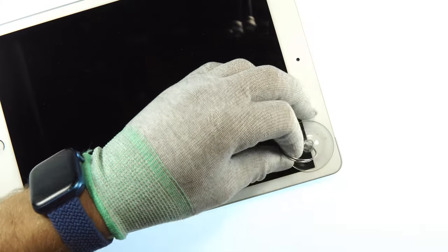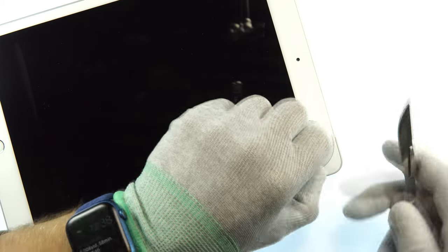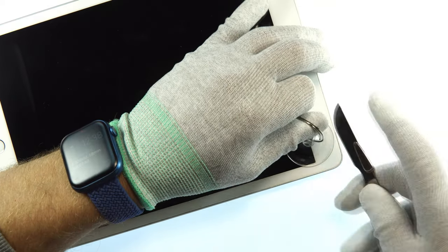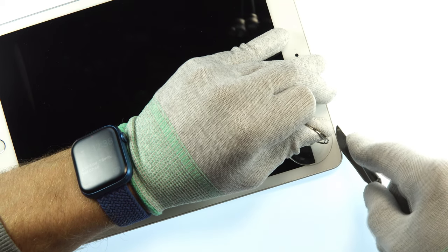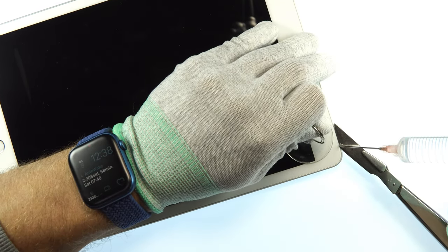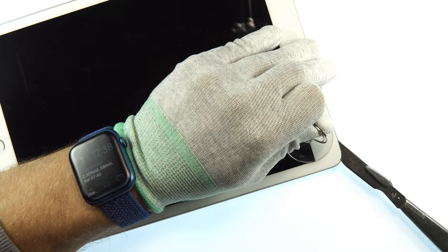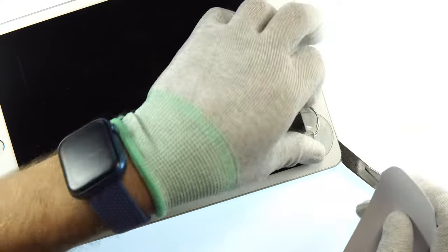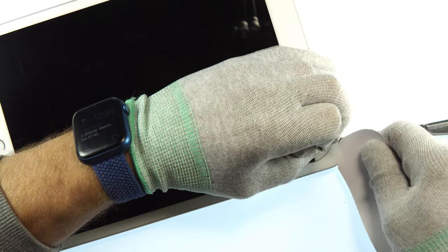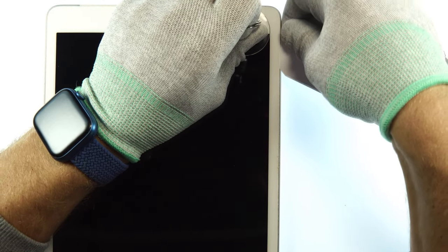Put the suction cup in the right or left corner — no worries, doesn't matter. Always use a protection glass — that's very important because if it cracks you'll get glass in your eyes. Next step is to take the scalpel and put it very carefully between the frame and the glass. Then take some isopropanol — don't use too much because it can go into the LCD and cause damage. Next take a thin plastic tool, or the thin chips from the set, and once you're inside, apply isopropanol again and slide very carefully down the screen.